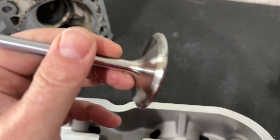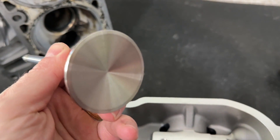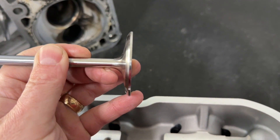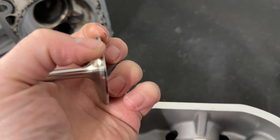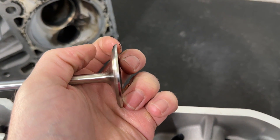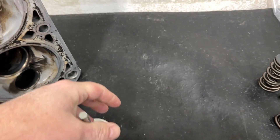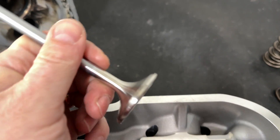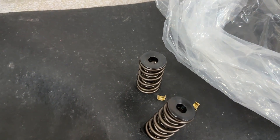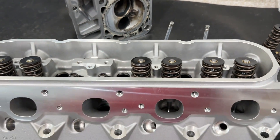These are cast in Mexico, so pick your poison. The valves that come from AFR are better than stock. This is a nice 2-inch valve with a big back cut — quality stuff. If you pull a factory intake valve, look at the margin — that flat spot right there — how thick it is, that gives strength to the valve. Pull out a stock one and it's almost like a razor blade, there's hardly anything there. The exhaust valve has a nice tulip design, much better material than stock. The valve springs that come with it are from PAC — pretty good.